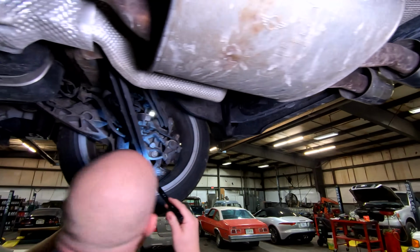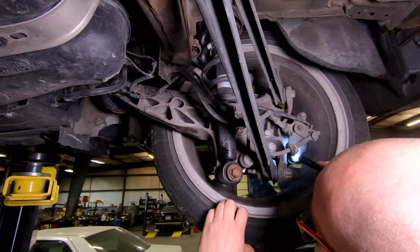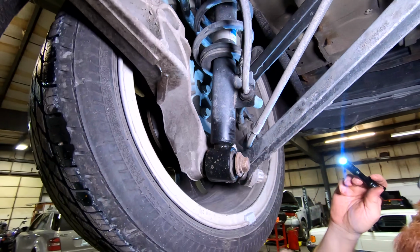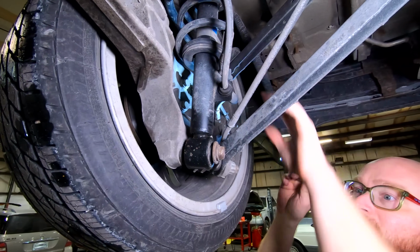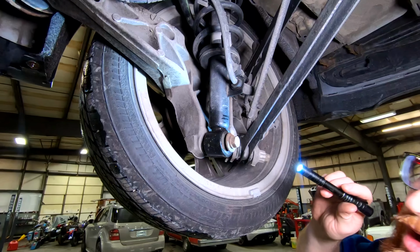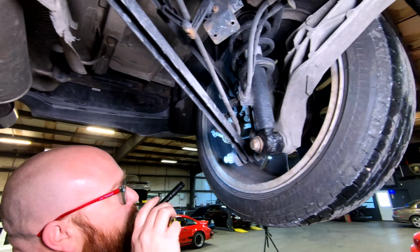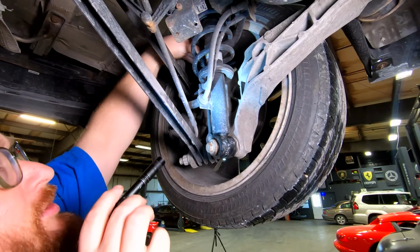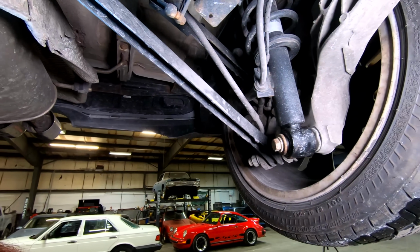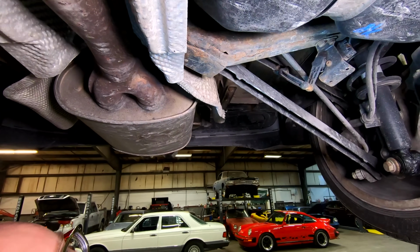Check out these wheels. It's got some Bilstein shocks on it. Pads are about 50%, but they're still good. Nothing loose. Sway bar link is tight. That's just water from the test drive it was just on. Brakes are good there. Sway bar link is good. Shocks are good. Nothing loose. Some more of that little bit of rust. Luckily, rust isn't a big heavy problem here in Kansas.